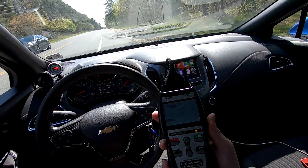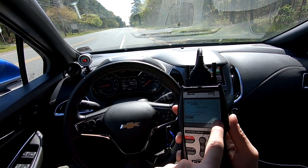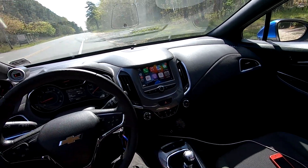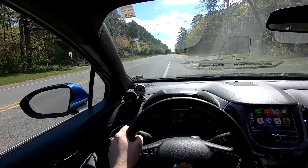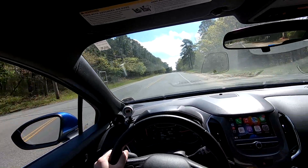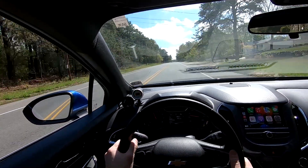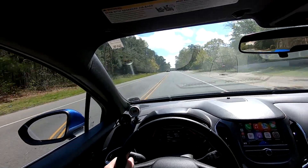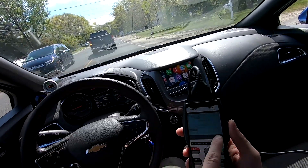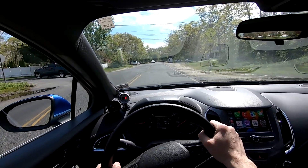After sitting for a while, the intake temperatures are now just shy of 100 degrees — we're at 97. I want to start driving and see the temperatures drop. I want to make sure this black intercooler is going to do the same as my non-coated one. After driving for about a minute, look — the intake temperatures are already down to 86. That's definitely a good sign.